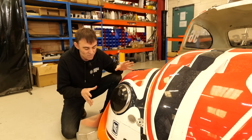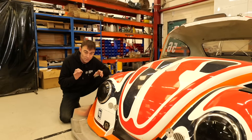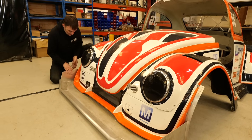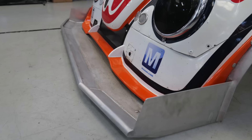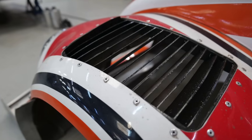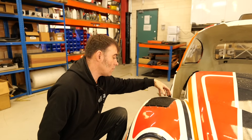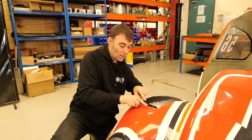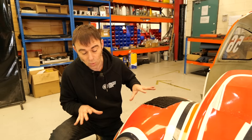I'll give you a little tour of all the aerodynamics mods we've done since the last episode. Starting at the front — which is very dirty, but I'll explain why in a minute — we'll start with the splitter. We've got a very specific design brief from Catesby Projects as to how the splitter should be, with this curved bit at the front, the angle at the front, the side walls, and these gurney flaps at the side. So all of this has very specifically been designed around their remit. We've also got the wingtops, with a little flap at the top to push the air slightly over, and then this vent system — these slats — which allow the positive pressure in the wheel wing area to be released and pulled out, creating a negative pressure to help suck it out. Those are on the front and rear wings.